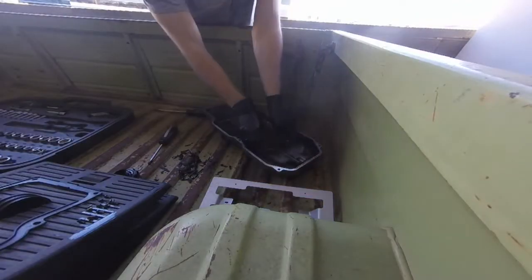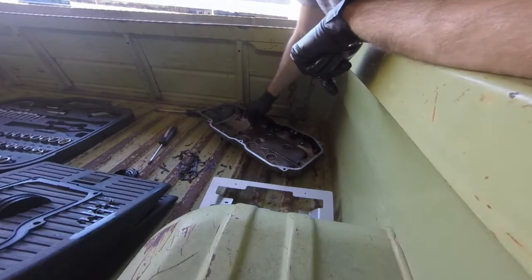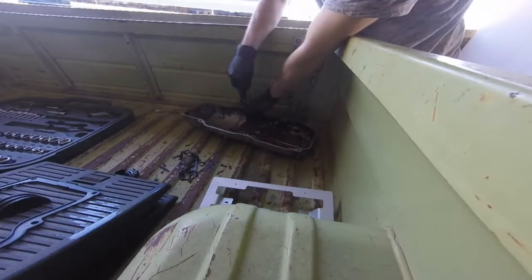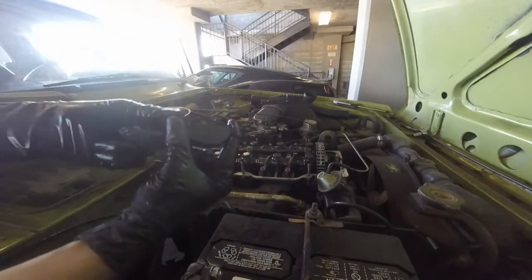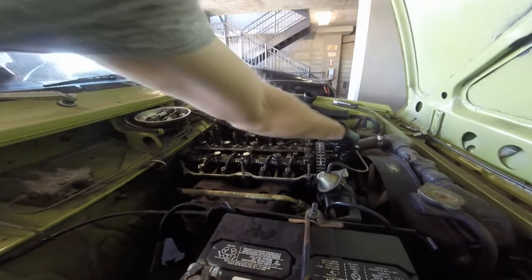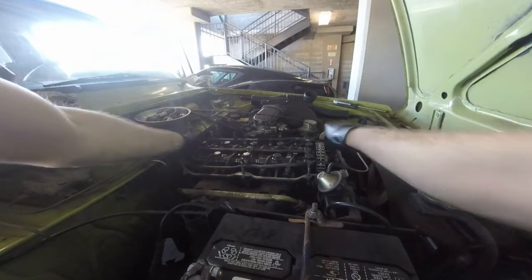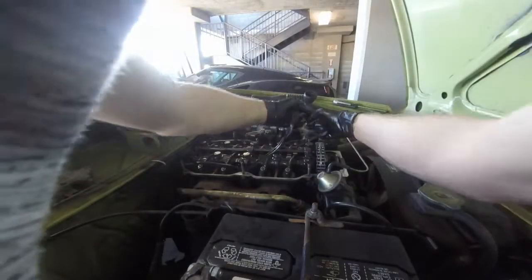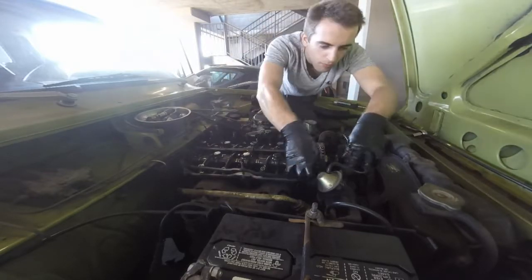The new one goes in. The baffle is actually really clean, which is good. If you see a lot of soot or oil in there, that means you're getting blow-by, because the exhaust gases are supposed to be going out the exhaust — not up into the crankcase. A little bit of pressure is normal, and that's also why all that baffling is in there. Oil does splash around, but the baffling is supposed to let the oil drain down and the air come out. I'm putting the end plugs in — I guess it makes it easier to turn the engine over or remove the cam.